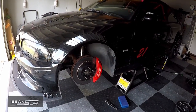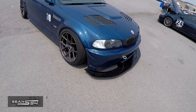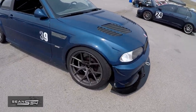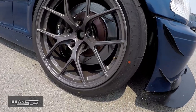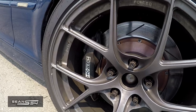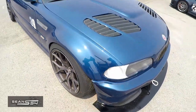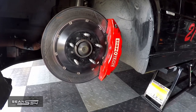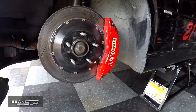If you watched my last video, I was able to drive my friend's E46 M3 track car at Laguna Seca Raceway, and one of the major takeaways driving his car was that his brakes worked really well. There wasn't any pad knockback and the brakes were very consistent. He has a four piston big brake kit all around. I only have the six piston big brake kit in the front and I suffer from pretty bad pad knockback.